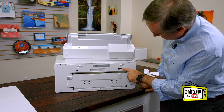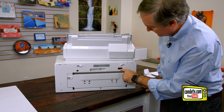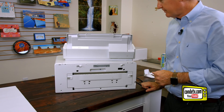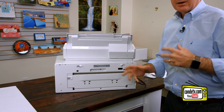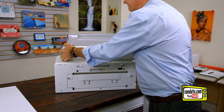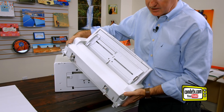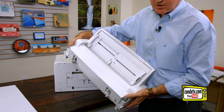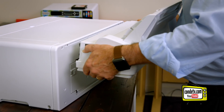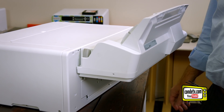The first thing I want you to note is this is the electrical connection to the bypass tray. Notice how it's moving around — your printer is not broken, that's how it should be because when the tray comes along it needs a little wiggle room to navigate. On the bypass tray you've got little push buttons on each side and those are the release mechanism. You push those down, mate the connector right in here, then release and it is locked in place. It is that easy.